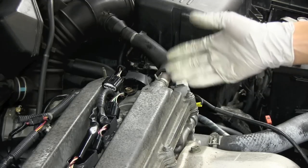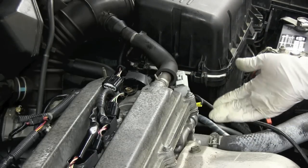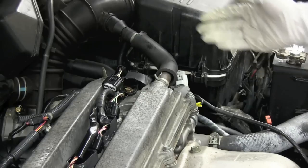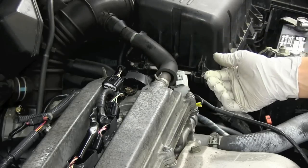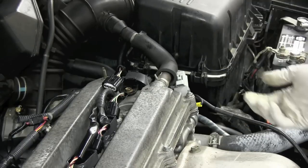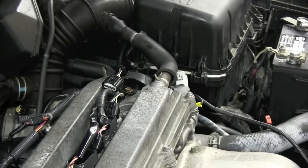Theoretically, we may have an issue on the cylinder that we just did a dry static compression test, a wet static compression test, a running compression test, and a vacuum test on — but we still might not know exactly what's happening based upon those tests. So another test we can do, which is sort of the end-all be-all, is the cylinder leak-down test. We're going to inject air into this cylinder and see how much air is lost, or where it comes out. Depending on where it comes out, we'll know what sort of problem we have and what we need to do next. Maybe this vehicle needs an engine because the piston rings are fried, or maybe we could get away with replacing the head — which may be cost-effective for the customer. This test is just going to give us more information.